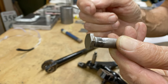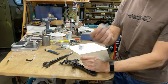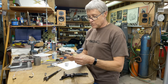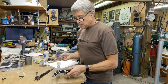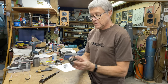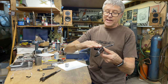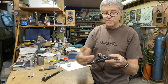I went online yesterday — if you need Cub parts, you go to eBay. I got the part number; for maybe 10 bucks including shipping, it's coming out of England. This hole has to be made smaller. I've got some 4140 rod — that's a pretty nice bit of steel. We're going to open up the hole and hold it in the mill. The first thing is: how do you hold something like this? It has to be level because the hole has to be perpendicular.